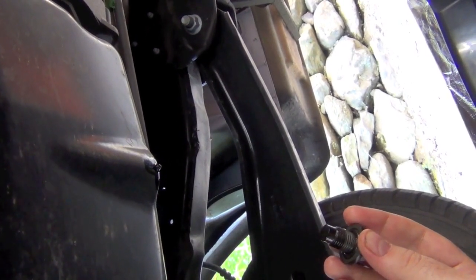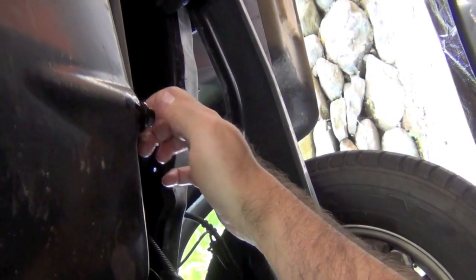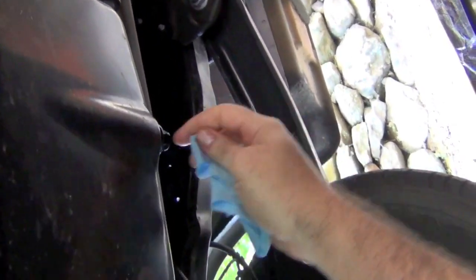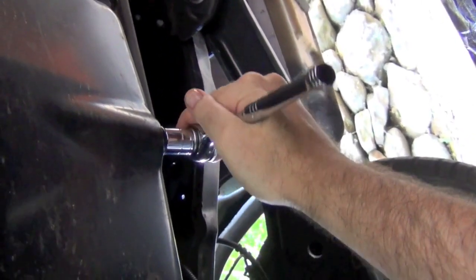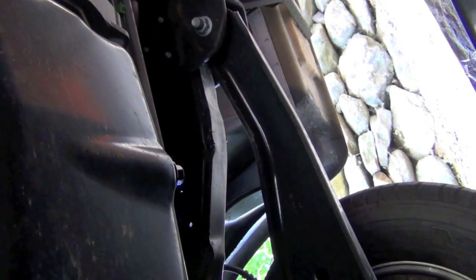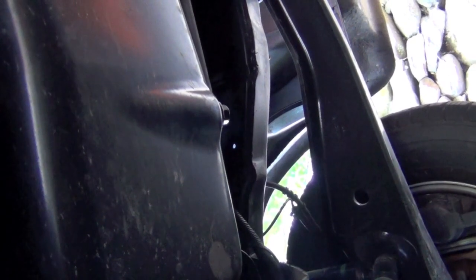At this point, very little old oil is left and we're going to get the drain plug back in and tighten it up. Get it most of the way in by hand, give it a clean, then use the ratchet. Really important: don't over-tighten it. If you strip the threads on the plug you'll have to replace the plug, and if you strip the threads on the oil pan you'll have to replace the whole pan. Get it in there nice and snug — that's all.